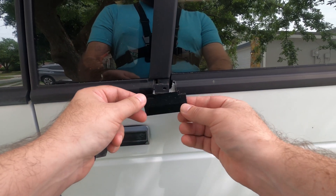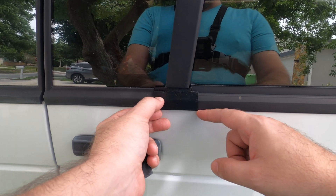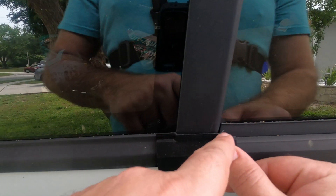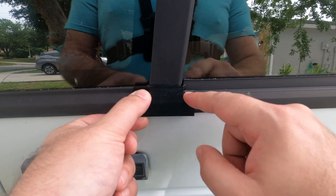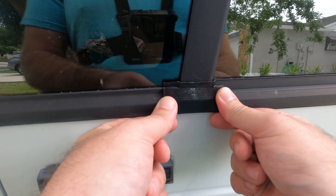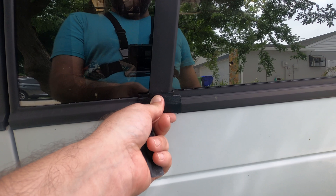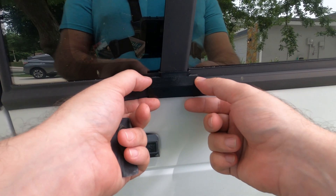Here is the first attempt. You can see it sticks out a little bit below the rest of the rubber and trim on the door, and it doesn't quite go back all the way at the top, so there are a couple of adjustments I need to make. I probably need to delete this entire upright part and extend the front end back a little bit so it nestles in there, and the back needs a little more adjustment too. It would actually not look too bad if I just put it on the car like that, but I'm going to work on refining it a little further, making some more adjustments, and printing another version.